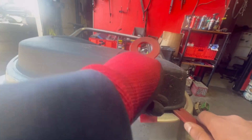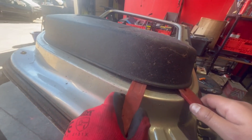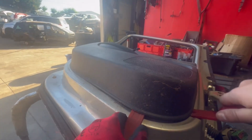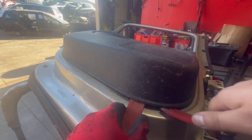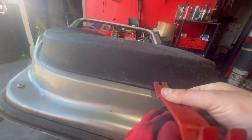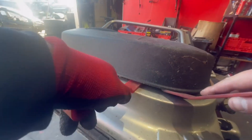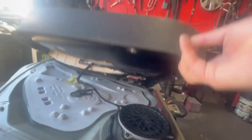Use plastic tools and go all along, starting from the bottom, to unclip the door panel. You can try to remove the clips with a proper tool; however, even that way clips have broken in the past. Generally they don't break, but keep in mind that they can. I will show you the clips once the door panel is off. It does take a little bit of patience and you'll need to apply a bit of force to get in between the door panel and the door itself.